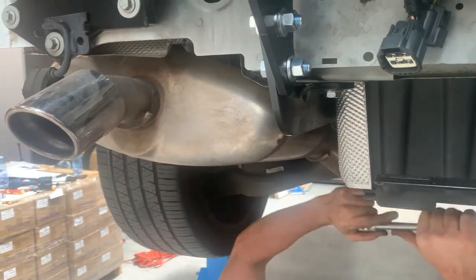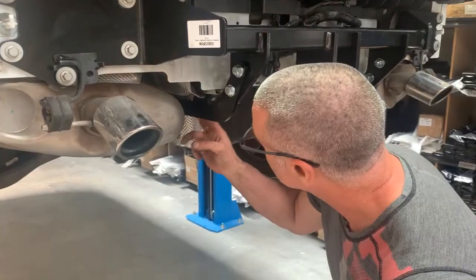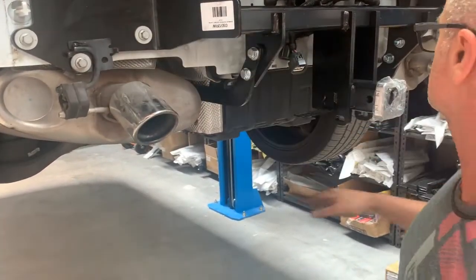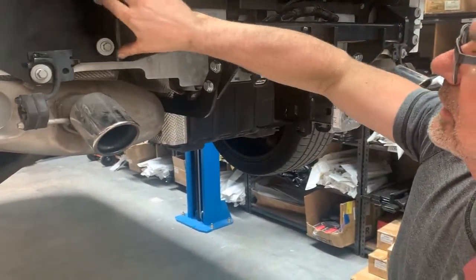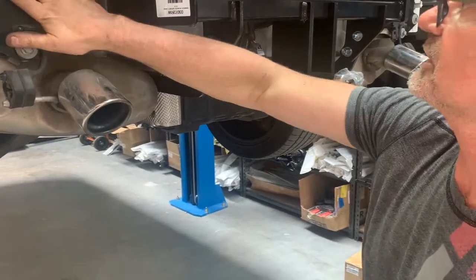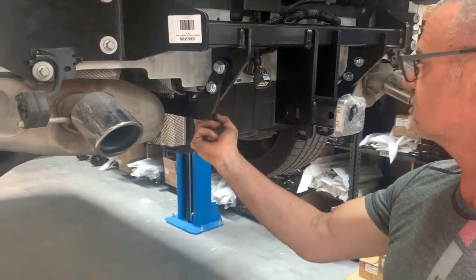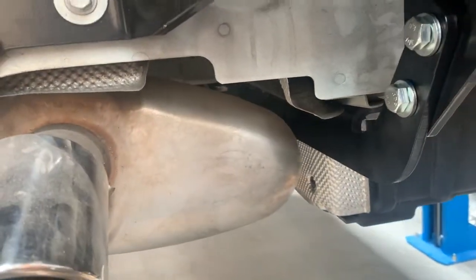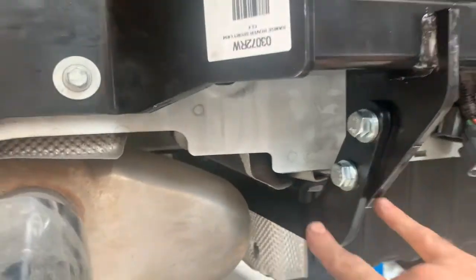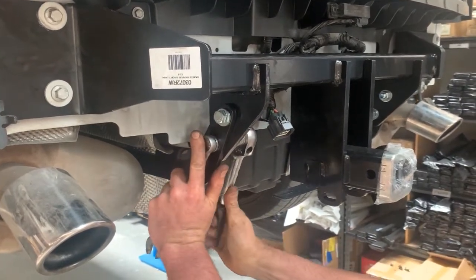That one's about right. We're going to do these two up the same on the other side. Pretty straightforward — up this brace here, it comes onto the tow bar. We did all these bolts nice and evenly and loose, leaving a couple of turns on everything. Using a torque setting is not really going to work — you're going to have to wind it in until this plate starts to pull and sit flush under the car. It takes a bit of experience, so if you're not confident, find someone else.